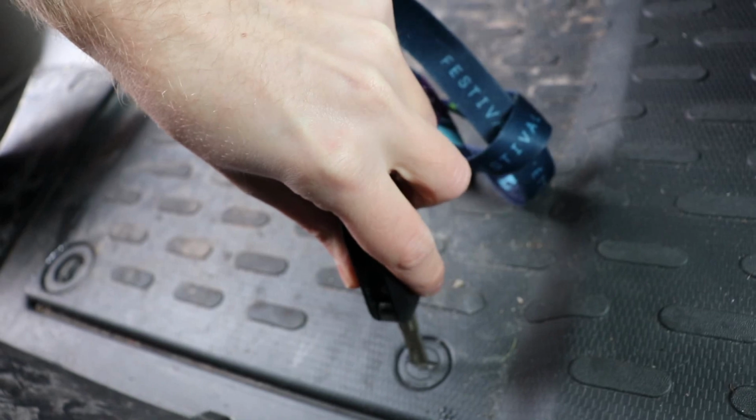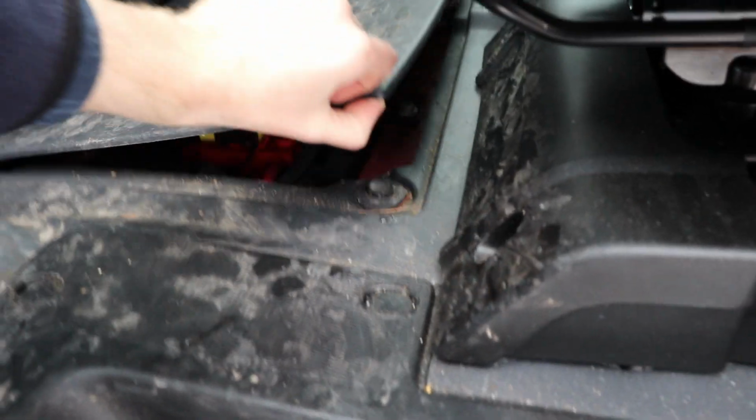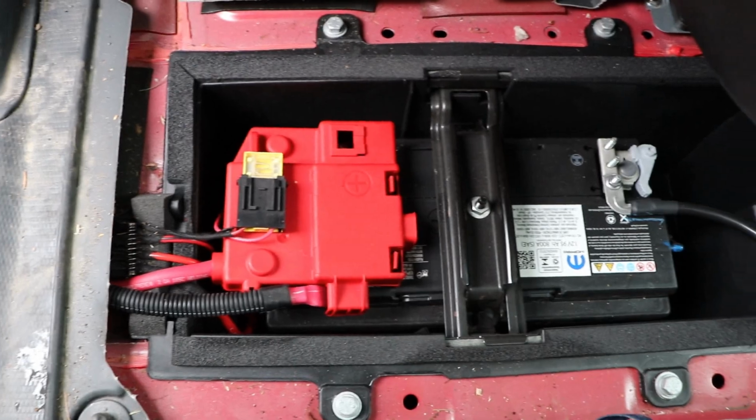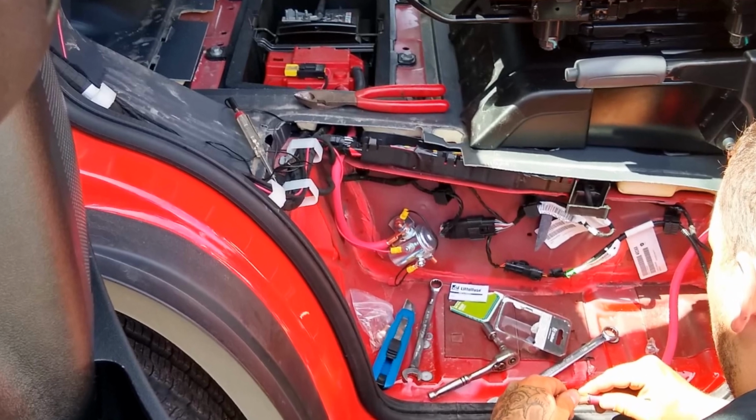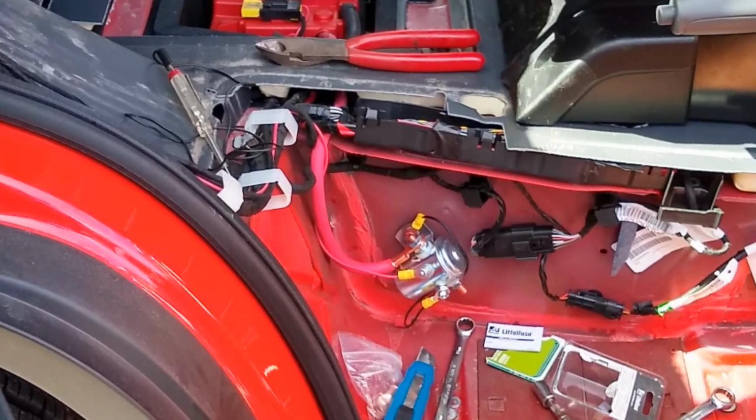So to access the ProMaster's car battery, it's under the driver's feet. Where the pedals are, there's some sort of board you can remove, and that's where you access the battery. And then we've connected a battery isolator on the side of the step of the van. Gab's cousin found a perfect place for it, and it fits perfectly. He unscrewed that, passed the wire, connected it to the battery, connected it to a battery isolator, and then from the isolator we have a big wire that runs all the way to your external battery in the back.